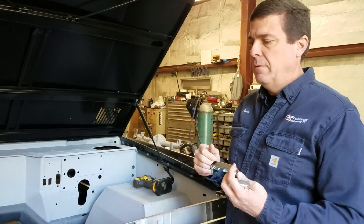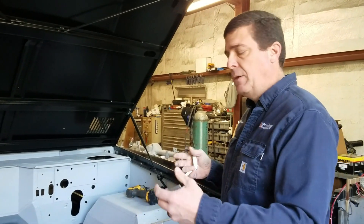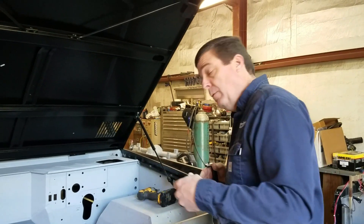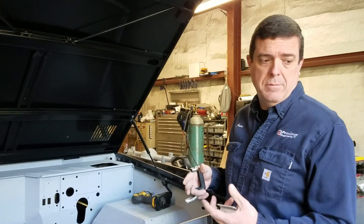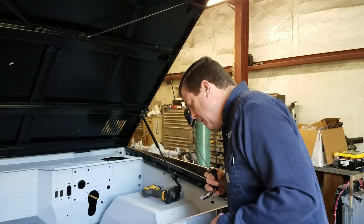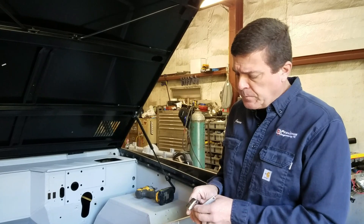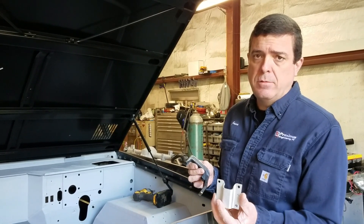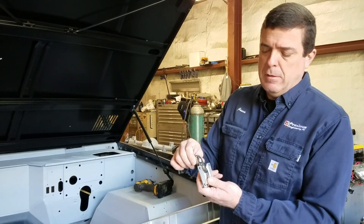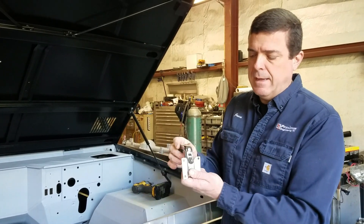All this is just a little bit of fitting you're going to have to do. Make sure you have the actual radiator you're going to use — don't just use one you have on hand, because sometimes everything isn't exactly the same. Setting the radiator in now, we'll get it placed and get this bracket positioned so we can get it spot welded. This bracket basically keeps your radiator stout — it keeps it from moving side to side and captures the upper brackets.